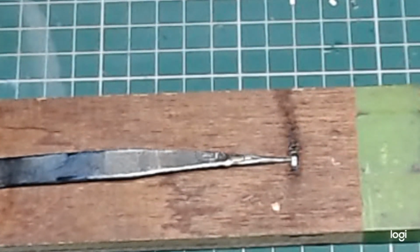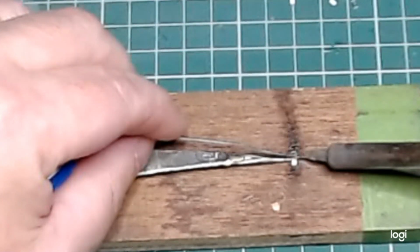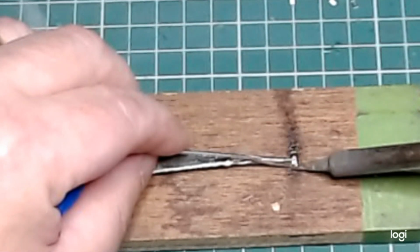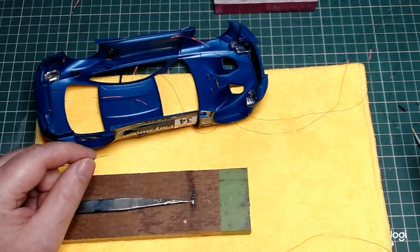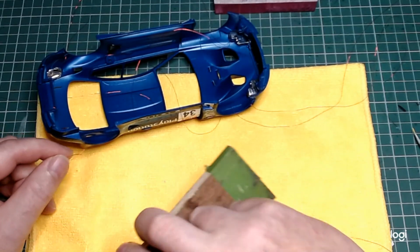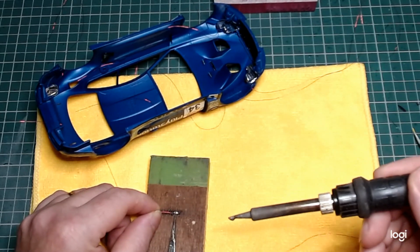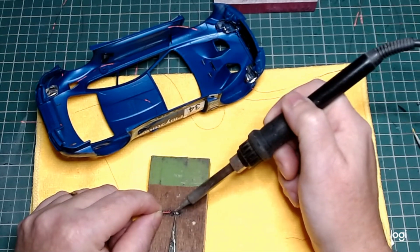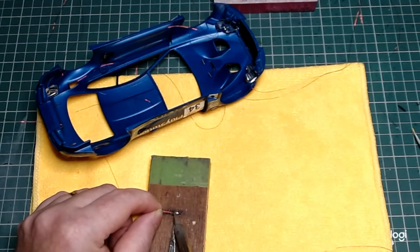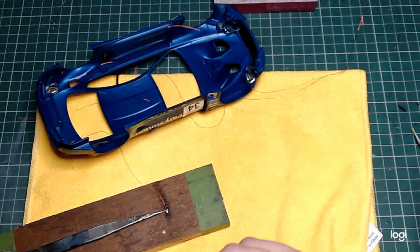Scrub your solder, clean your tip, it needs to be clean. And just tip either side, just enough for your wires to be soldered to. Right, we're ready to put our first resistor on. So again, same as before, as I said yesterday in the last video, you're really only tipping these wires onto the resistor itself. Too much heat through them and you'll burn them out. That's one side on. And then the other side. And then we'll be able to test it and see what it's like.